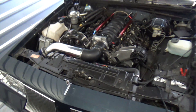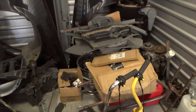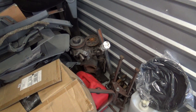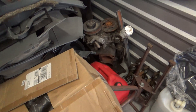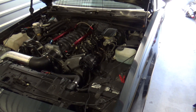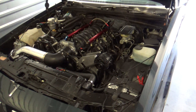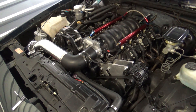Anyway, back to that Grand National — I basically parted it out down to the shell. I still have the frame and basically just the doors and the body. The interior's been parted out; I've got some of the parts over here that I'm keeping. There's the engine that was in it, which is not a turbo block — just a naturally aspirated 231. You could drill it for the turbo drain if you wanted, and actually I think it already is drilled. So I took the rear end out of the parts car — it's in this car now, the 3.42 posi rear. The steering box out of that car, since the Grand Nationals were equipped with the quick-ratio steering box — it's in here now. And the sway bars, since they're bigger in this car, I bolted the front sway bar to this car. That's really everything out of the Grand National into this car.